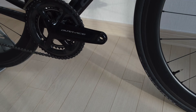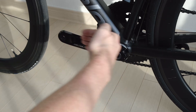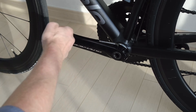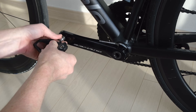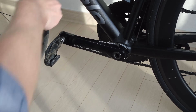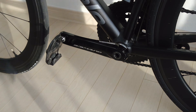Here we are — I've turned the bike around and as you can see it's the non-drive side. The crank arm is facing at the nine o'clock position. To put the pedal on, we again want to tighten toward the end of the crank arm, so this time it will be anti-clockwise. Do it with your fingers first, otherwise you could cross-thread it. She's already bitten — she's on — then use the Allen key to finish it off.